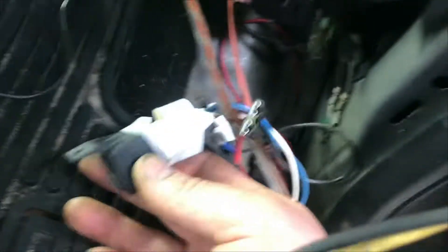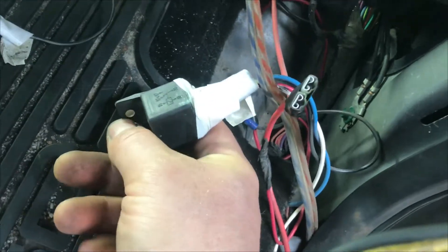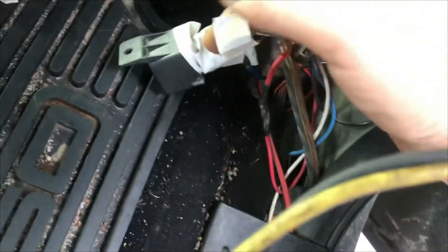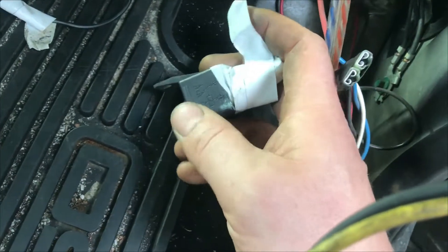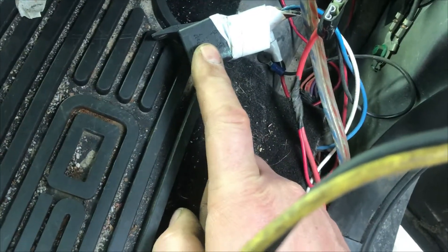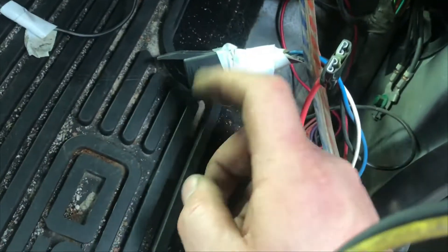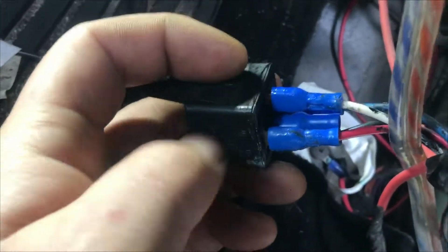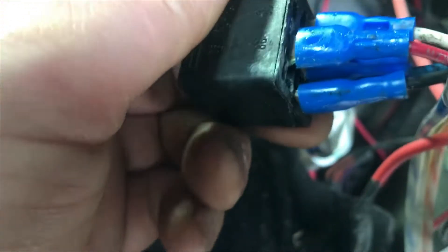The customer wants to know what's actually wrong. It's not worth trying to diagnose aftermarket stuff and reverse-engineer everything — no one's willing to pay for that, it's too time-consuming. We do see a whole bunch of corrosion on this relay, so let's open this up and maybe change the relay. It's possible the relay is just getting stuck on and replacing it will fix the issue. With the tape off you can see all the crud in there.